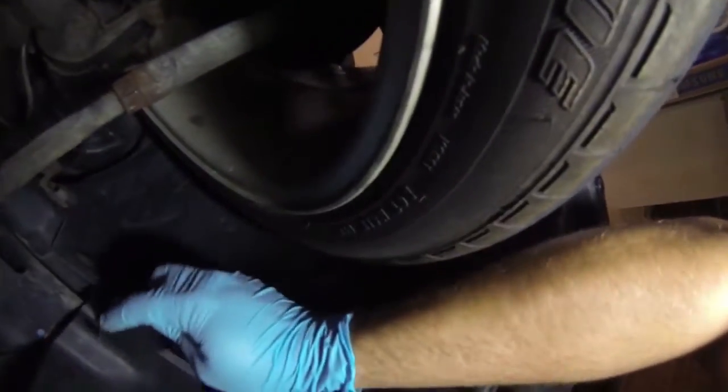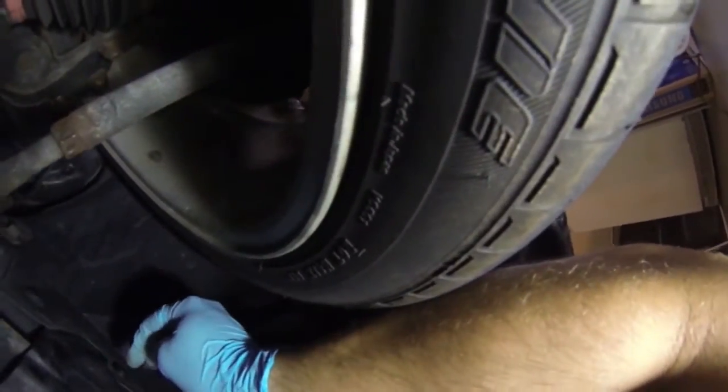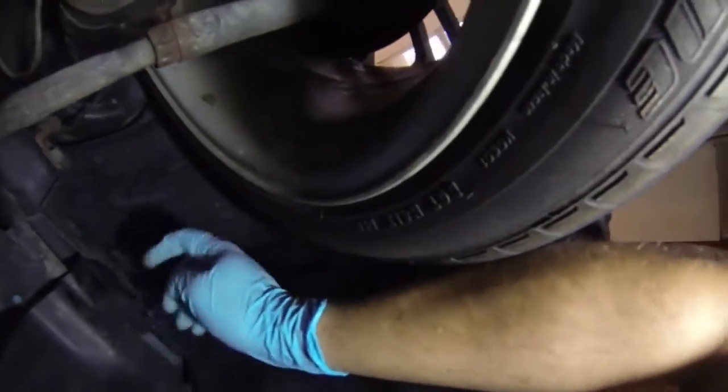This underbelly goes under the wheel well, and you'll be able to take a clip and put it, if you line them both up, there we go. Boom, got it. Alright, so now the wheel well goes on top, then the underbelly pan, and there's a clip that goes through both, snaps into the side of the car. So we'll take this, like my other clip, which I keep missing. There we go. Got it. Now we'll take my light, go to the other side.